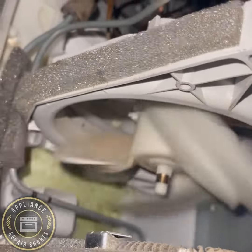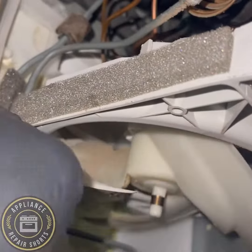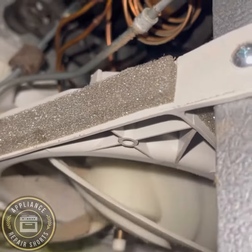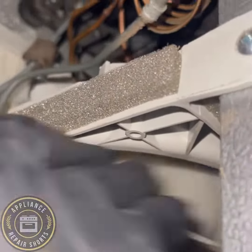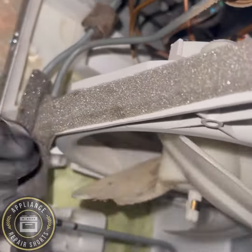The fan is not always bad — you can unstick it. The video is sped up. Sometimes you want to remove the fan blade and pull it off to make sure you don't have any lint built up behind it. Sometimes that's all it is — just restriction holding the fan back, or sometimes grease will get behind it.